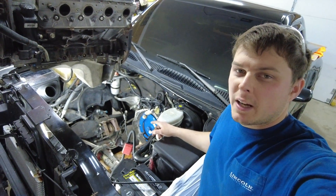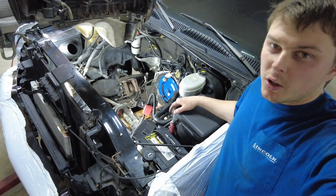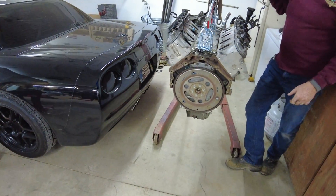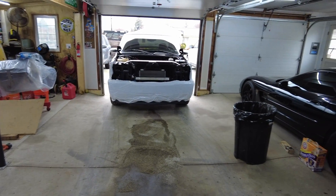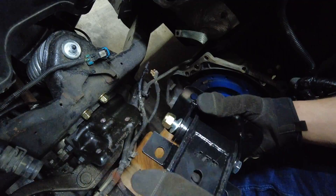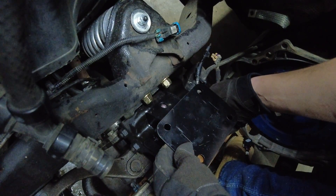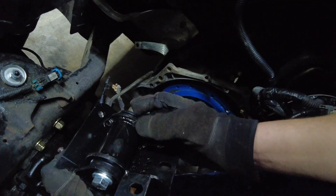To support the transmission while we push it backwards, we have a two-by-six up inside that goes in between the subframe underneath the front differential and rests on the sway bar, supporting the transmission right there. Now I can take the engine stand, bolt her up, clean up all this cat litter, push the truck back in, close the doors, get the heat back on. Here are the AFP motor mounts — this has a bushing inside. They do have an option for a solid mount, but I chose not to just so it doesn't beat me up at a stoplight. It sits right there on that little horn with three little holes. These bolts are a pain to get out because they have red Loctite on them, and then it's just a nice smooth solid plate to mount the engine block to. Pretty nice quality — they are a little expensive, but you get what you pay for.